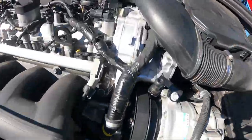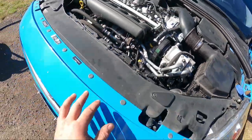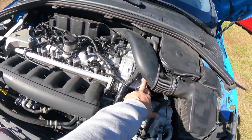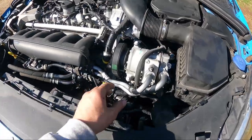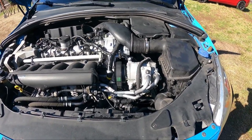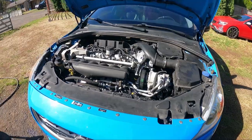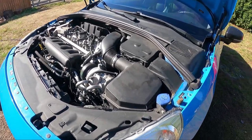I'm gonna put the strap bar on, bolt it back, put the covers on, and put the airbox on — and we're done. This is all clean and beautiful now — blew it out, let it dry, cleaned it nicely, and sprayed with degreaser, which you also saw from underneath. This is the oil — well, the vacuum pump — on your driver's side. If you're in Europe it'll be on the left side of the vehicle as viewed from the front. You buy a vacuum pump seal kit — IPD sells them, and others should too. The kit has two seals and a small plastic adapter with seal.